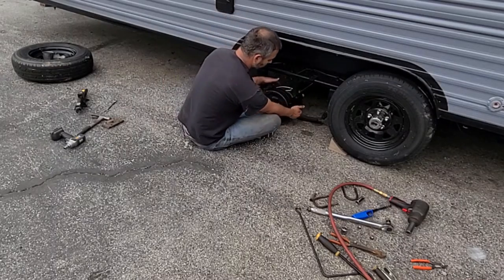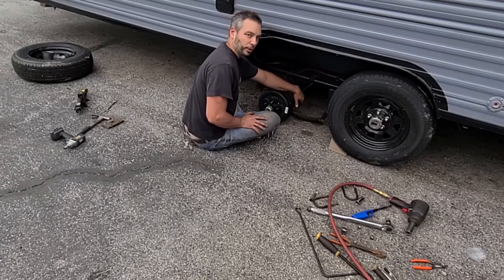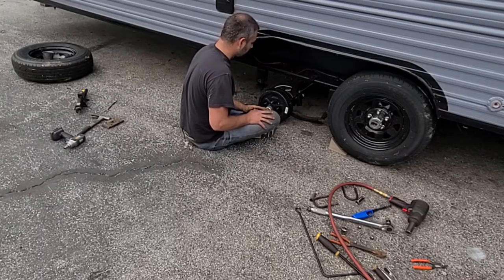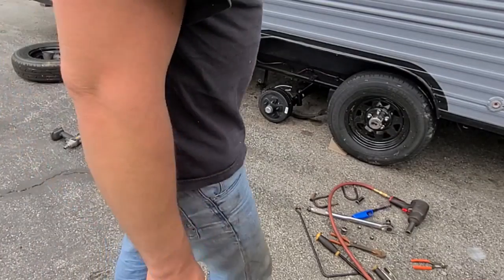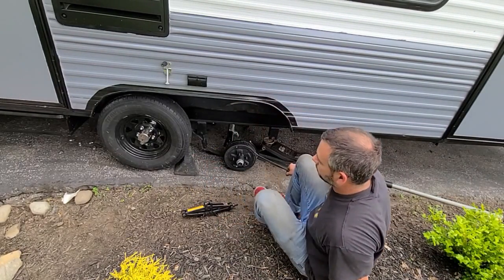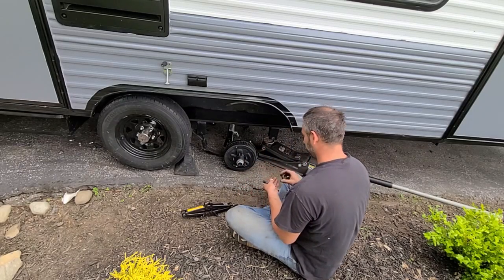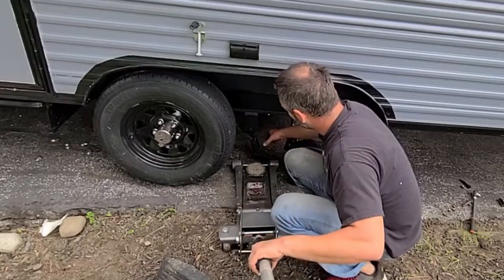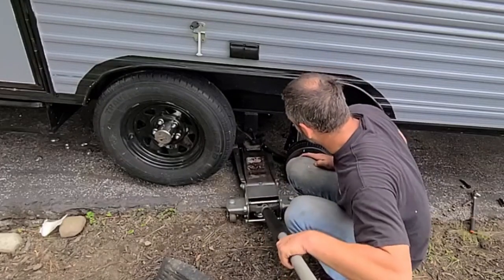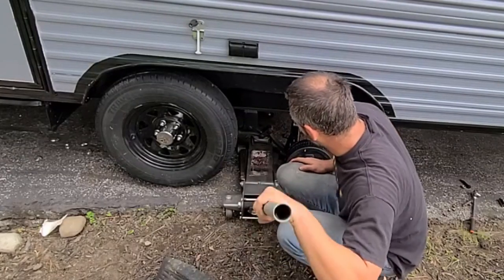These back in place, and then you can rotate these around and let them settle on there. They will sit by themselves without being bolted down on this flat part of the spring seat right here, but it's got to be pretty much level and fixed, otherwise it's just going to want to roll off. So I may go around to the other side first, just because the floor jack is already over there. It shifted, I guess, because the spring shackle rocked forward. Try to get that straight.